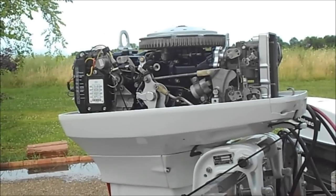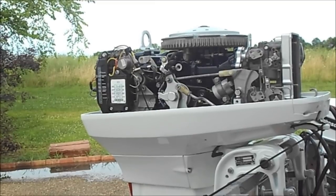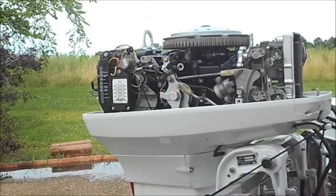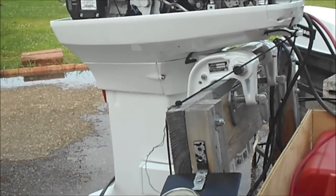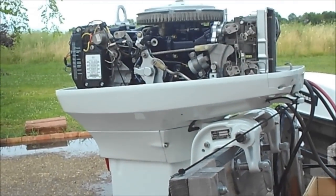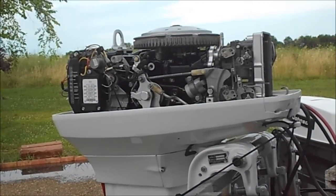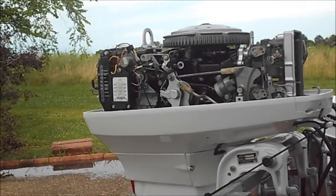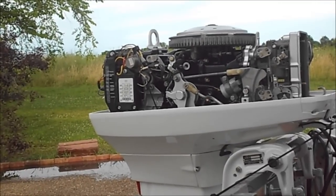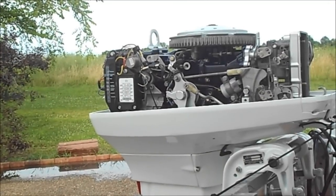The motor was painted with automotive grade paint, as you can see in that really nice deep navy blue. And so I figured if I could do all this pretty stuff to it, the most important thing would still be having a good solid engine. And the compression is right around factory spec. Each cylinder is about 142, 143 psi, which is great.